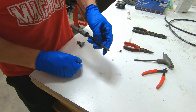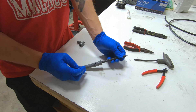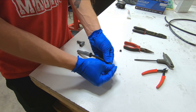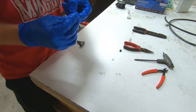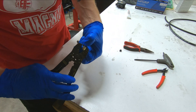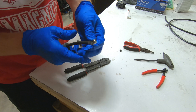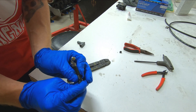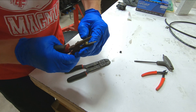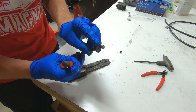Now that we have the wire exposed, it's time to put the little 90-degree HEI pin on it. You can pay attention to how you index these in relation to the MSD logo if you would like — it doesn't really matter, it's mainly just aesthetics. I like to put the pin so it's right in line with the MSD logo like that. Making sure that the wire doesn't protrude too far above the crimp pins, I'll take my simple crimp tool, squeeze down on it, and now it's crimped in place. One thing to notice is the crimp bent the top of the pin over, which will not allow it to properly fasten onto the coil pack. So I'll take a pair of needle nose, gently grab onto it, and pry until I get it back up straight again. Be careful not to apply too much force because you can break these pins pretty easily.